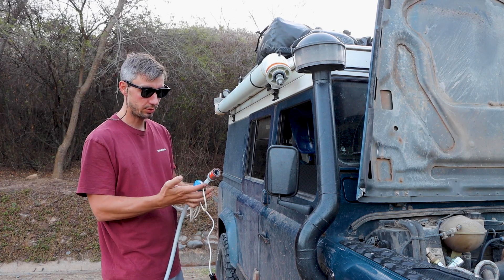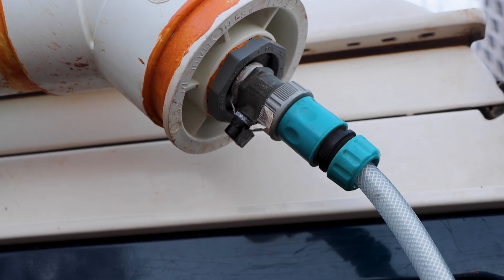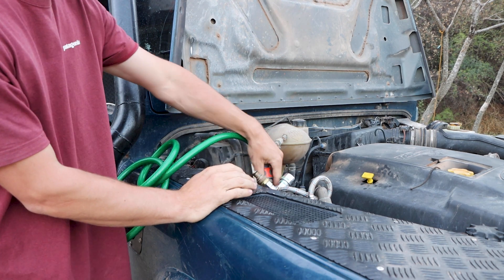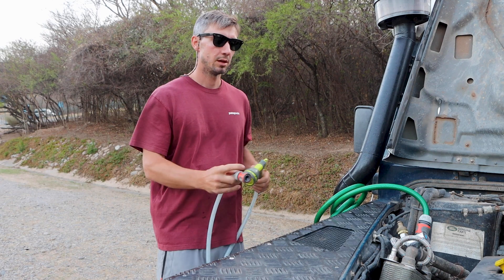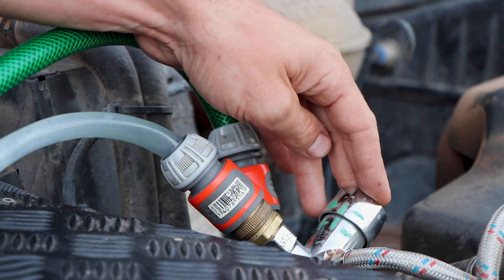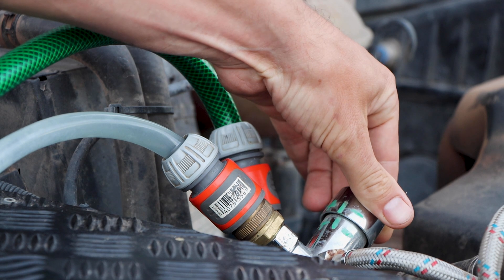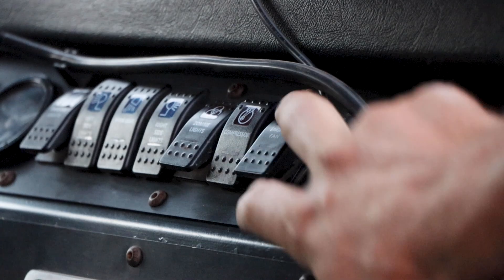To use the shower, we connect the 12-volt inline pump to our water, then connect the hose to the cold water side that's connected to the heat exchanger and to the mixing valve. Then you just connect your shower hose to the outlet. We have the mixing valve set to a nice shower temperature — there's not much you can set, so we marked it to always have it right. Then basically switch on your coolant pump, switch on your water pump, and you're good to shower.